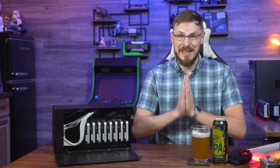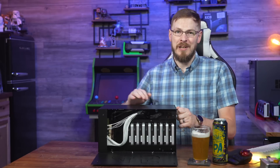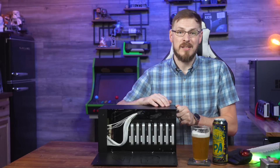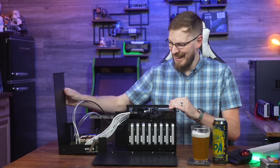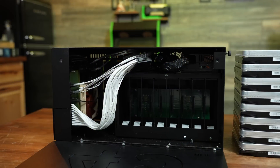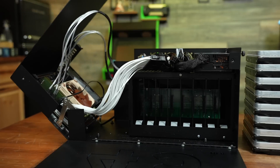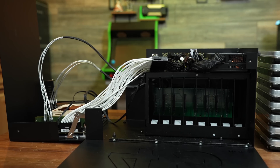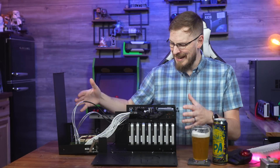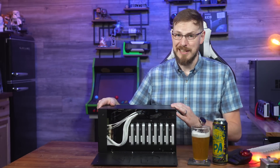If you want to build your own, what is the HL8 like to build in? Well, this is a neat party trick I've been dying to show you. Rather than removing panels entirely from the HL8, it actually unfolds kind of like a flower, making everything accessible just by turning a couple of captive thumb screws. Everything is laid out, easily accessible, easily installable. You've got access to your power supply, the drives, the cabling that goes to the backplane, and your ITX motherboard. And then it all just folds right back up together. It's a really slick design.